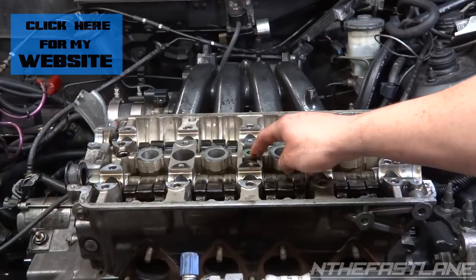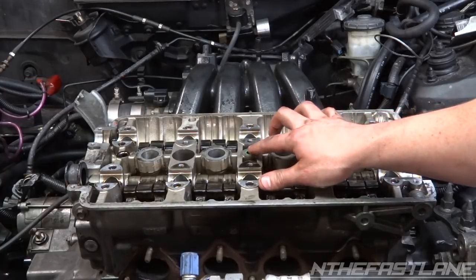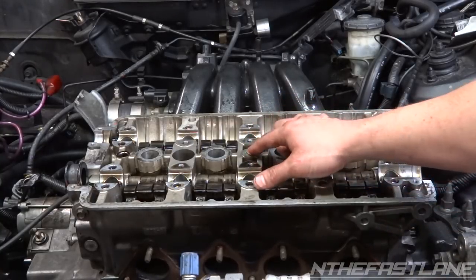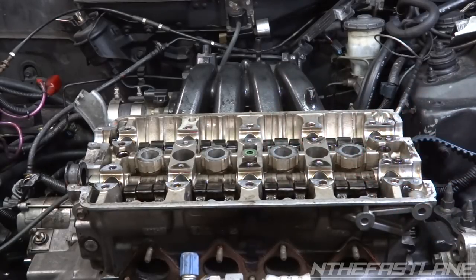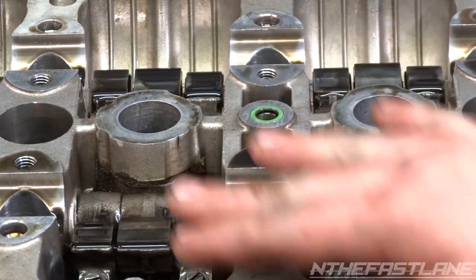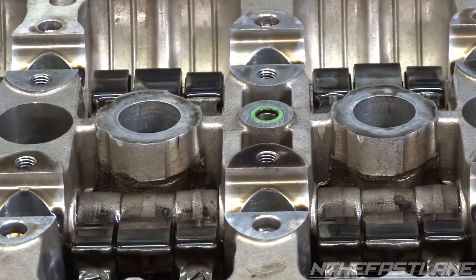This little o-ring right here — this rubber o-ring — this is where some people don't put one in, or it's flattened out so bad that the oil pressure starts shooting out into the head or the valve cover instead of going up through the cams and popping VTEC. So that could be your problem. Just pop it out, find the right size, put another one in, torque your cam cap and cam cover back on, and you're good to go.